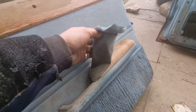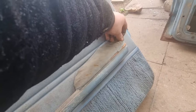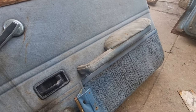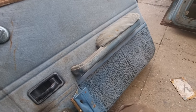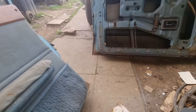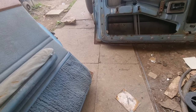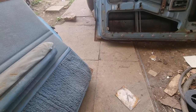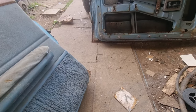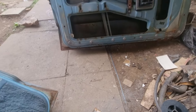All this is coming off — I should be able to redo all that. I'm pretty good with fabric because I had to do the seats in my camper van. Now that I've started in the middle of the vehicle, there'll be time to take the door posts off, do all the repair on the inner bulk, clean it all up, seam seal it, and then it'll be the floor and the inner sill — that'll be at the same time as the door post.